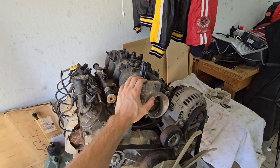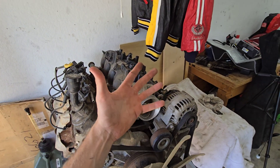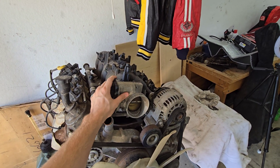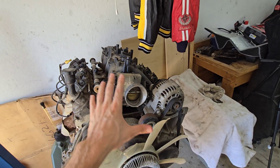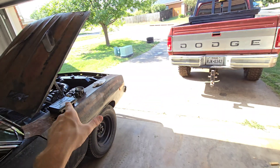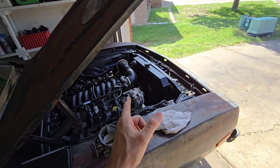I'm talking as if you're brand new to all this and trying to learn. Drive-by-wire, when you're doing your first swap, is probably the route you don't want to go. Most no-start or idling issues — really any issue with the engine not starting or running well — nine times out of ten it's the drive-by-wire setup. It's not as simple as drive-by-cable because it runs through a box that connects to the pedal.